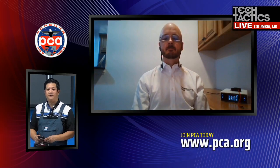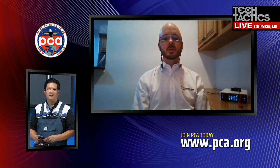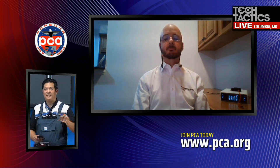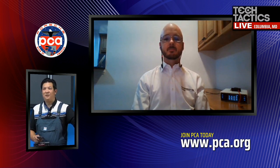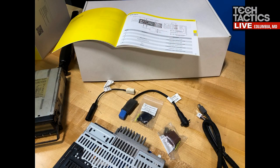Okay, so back to your first one about getting the cable if you have a good amplifier. Are you saying that I didn't have to make that harness? I could have bought that DIN cable? No, it's a small adapter that goes to the DIN cable that you already have. As you disconnect the original DIN cable from the radio, it'll adapt over to the back of this radio. Oh, okay. So it would have been an adapter to fit onto the existing DIN cable on this car, but because I only had half a DIN cable on this car, that wouldn't have helped me out. Exactly. Gotcha.